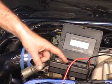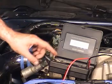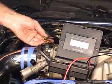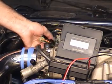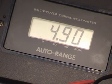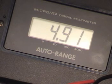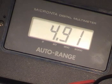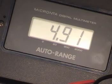Next, I change my scale to volts and I turn the key on. Now I want to check the reference voltage. On this one, it happens to be the orange wire. I'll back probe that and see what I get. We have 4.91 volts, and that's what we want — very close to 5 volts, give or take a tenth of a volt. That's a good reading. So reference voltage is correct, and the reference voltage is pin 26 of the processor. So we know that's a complete circuit.